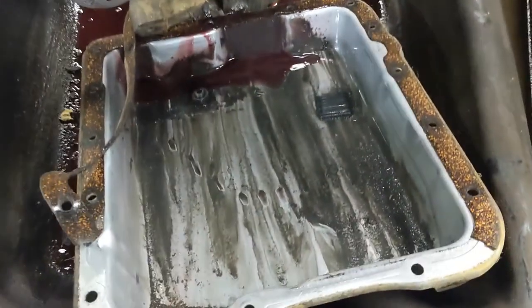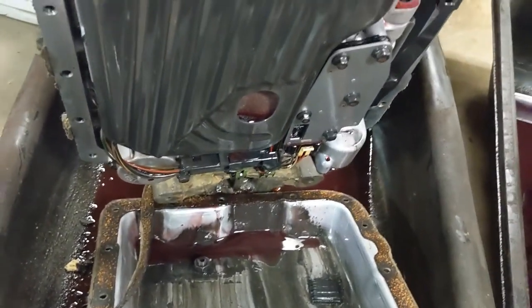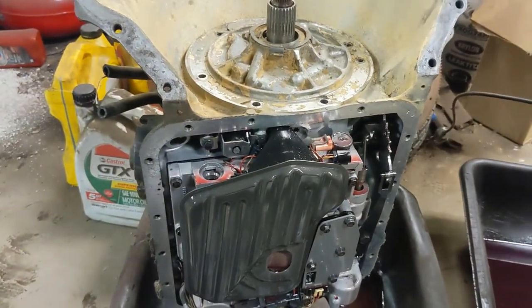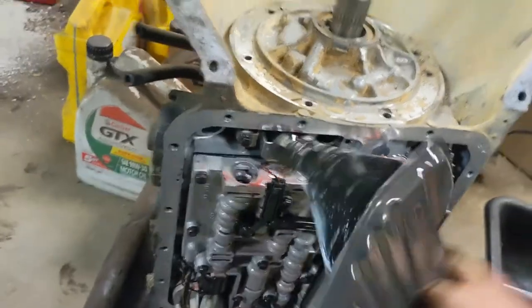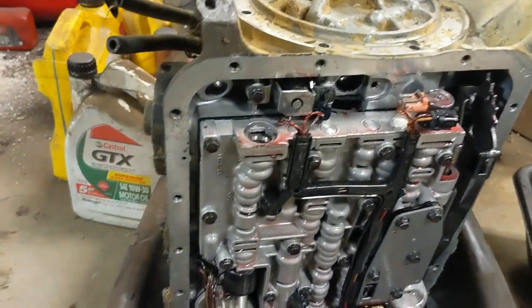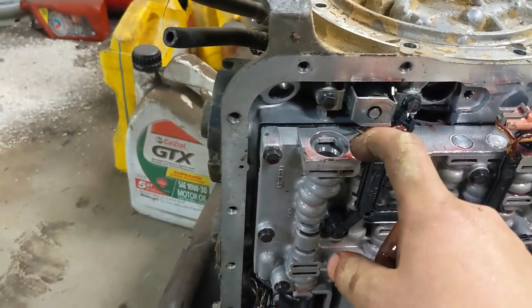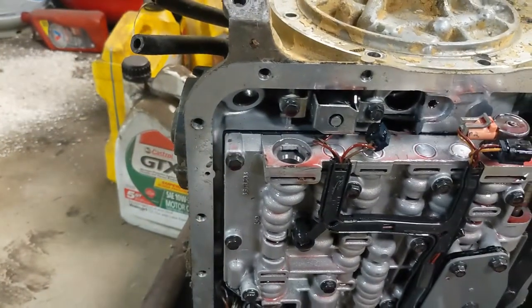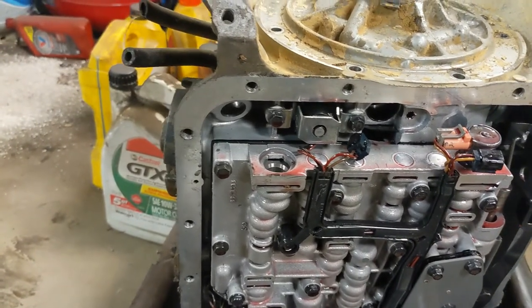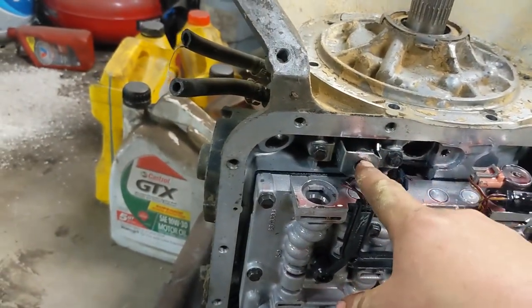Now that the pan is off, it looks like there's a little bit of clutch material in the bottom of this pan, but it's really not too bad. I think this transmission's in pretty good shape. Too bad we're only stealing some parts of it. I'm going to go ahead and pull the filter off next. So now what I understand is we need to actually remove this piece here. I'm far from an expert on a 4L60E — I just watched some other videos to learn just enough to be dangerous here. We're going to go ahead and pull this piece off because it engages into the pump somehow.